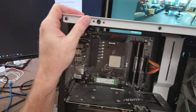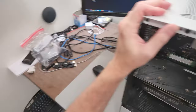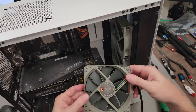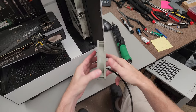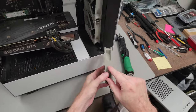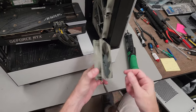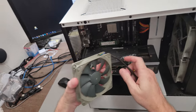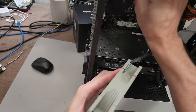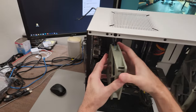I'm a little concerned that we don't have the original AMD AM4 back plate, and I think that the CPU cooler requires the original. Let's put this back on — looking at the direction of airflow. There's a little arrow on most fans that tells you the direction that the air flows. We want it to go that way so it takes the air out the back of the case. I'm going to put this kind of through there at the top so it comes through and we'll bring it back to plug it in.